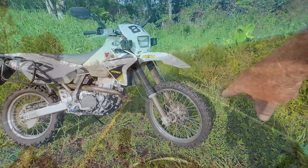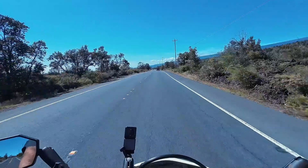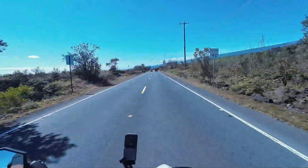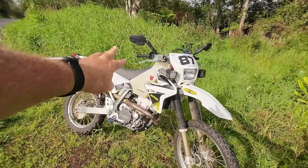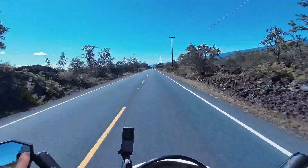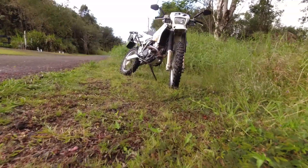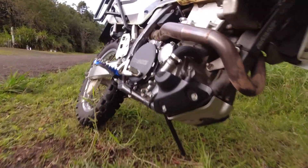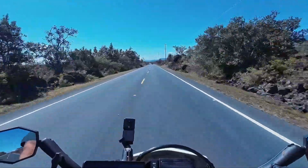I have a Tusk D-Sport hybrid on the front. I went to Rocky Mountain ATV and ordered new Racetech springs to help suit my riding style and my weight. The ride is so much better — a lot less pogo-ing, not as much bottoming, it's just so much more composed. It's the first time I ever did a suspension job on a motorcycle I've owned and I should have done it to every motorcycle.